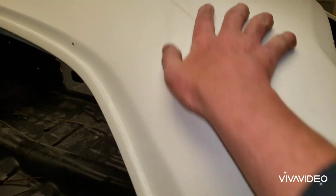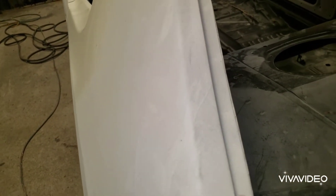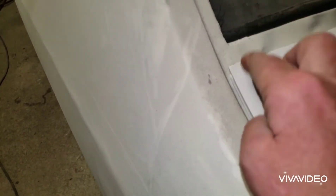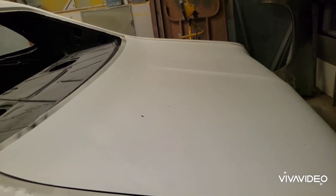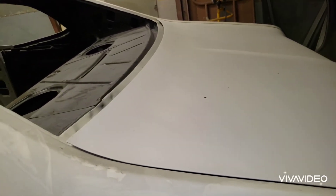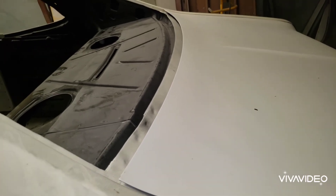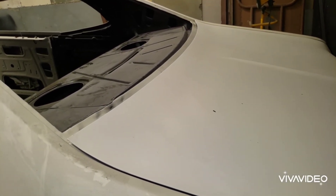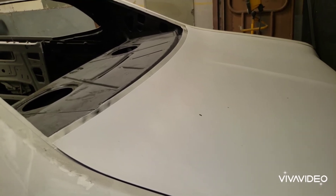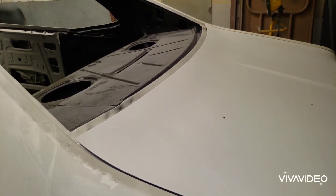Other than that, I've got the sides done really nice — I took care of them a while back. The places back here where the deck lid was all messed up, and there were some spots down here. When I was putting the deck lid off and on, I dented it right there, so when I put it back I'm going to need help. I had planned on painting this car with the deck lid on, but it's not going to be doable because I just cannot get paint down inside the jam area underneath there — it's too tight. I might be able to do it with my little touch-up gun, but going from a 1.3 tip to a 0.8, I'm worried about color match. That's my OCD kicking in.